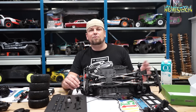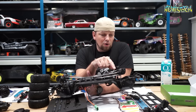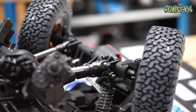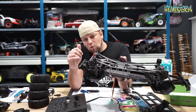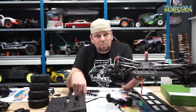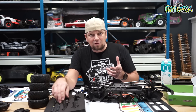Apart from the drive shaft, I have the front axle in. The most noteworthy observation is that on the portal axles, your links and shock bottoms lined up through the exact same mounting hole, but those have been separated on these new standard AR-45 axles. There's a tiny bit of a geometry shift in the front, so you need to lengthen your lower links and top link. You also get a new Panhard mount and a new Panhard bar. This axle looks really sturdy — compared to some AR-44 axles, with this built-in truss, it's a high-quality item.